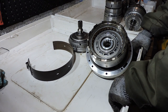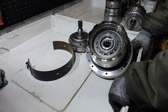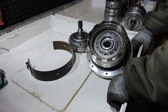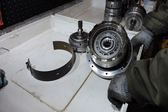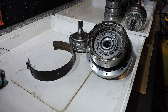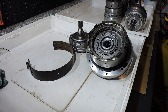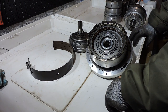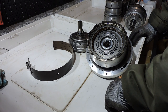The general idea is that a gasoline engine has a certain torque curve, and at a certain RPM it delivers maximum torque. Preferably you want to keep the engine around that maximum torque RPM for the most benefit and best fuel economy. It's not possible to stay at max torque RPM indefinitely because you need to shift gears — otherwise you'd accelerate to a point and never go faster. Using multiple gears, you can shift up, put your car back in the power band, and keep going faster.